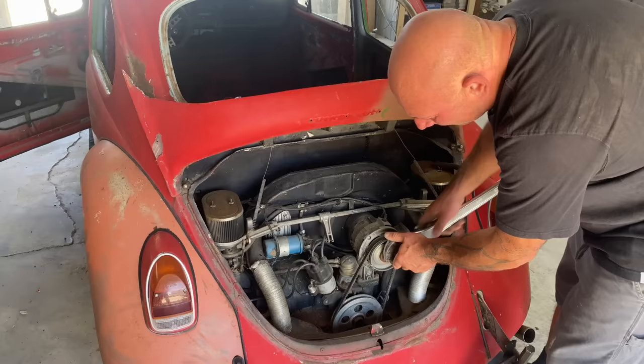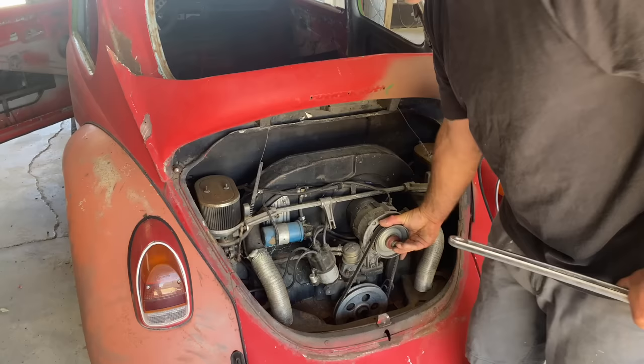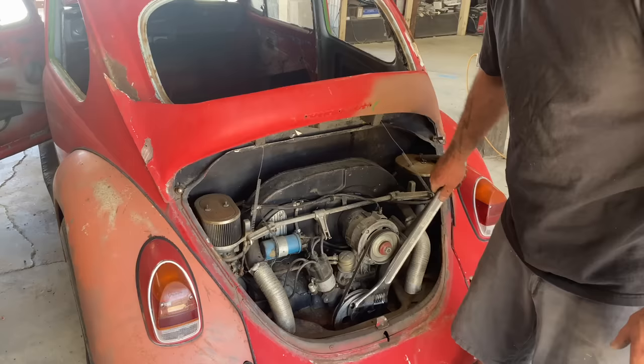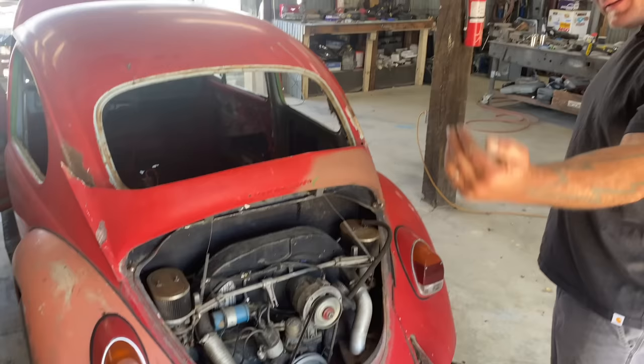Let's try to back it up a little bit. I really didn't need to spend my time doing this, but there's an adventure around every corner. Nope, won't go backwards further than that. The nice thing is, you know that. Oh, look — it hits again right there. There's definitely something going on inside. Get to that point — boom, boom. Maybe a valve came out. It could be a valve that dropped, pistons coming up hitting the valve.